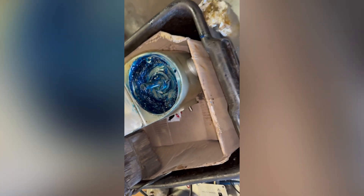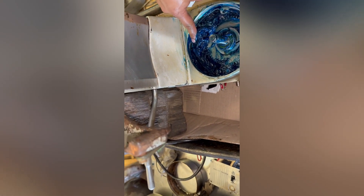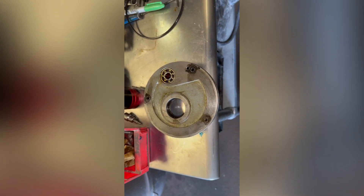We tucked a good amount of grease in there. This machine probably was the first time getting opened — we're talking about decades of no service on this unit. The grease was actually very liquidy, very oily, black and dark. But we got a good amount of fresh grease in there now, nice and clean. We're now going to assemble the last remaining parts — we still have to put the planetary gear in and then we'll be done with it.